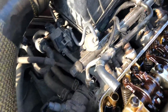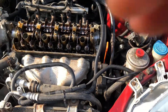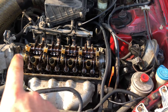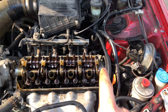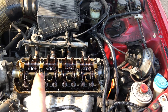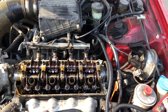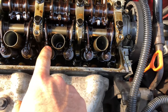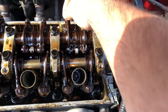So we got here: the Y7 head, Y8 cam, Y7 cam gear, all Y7 cam caps, and the Y7 rocker shafts — both intake and exhaust. I have put all the Y8 VTEC rocker arms on both intake and exhaust with a locked VTEC up here. It's kind of hard to tell with the tight valve lash.